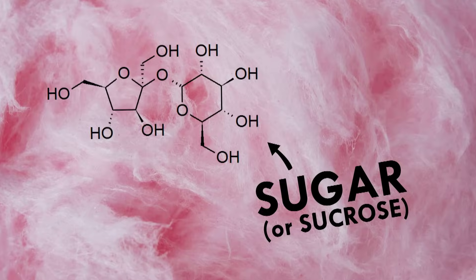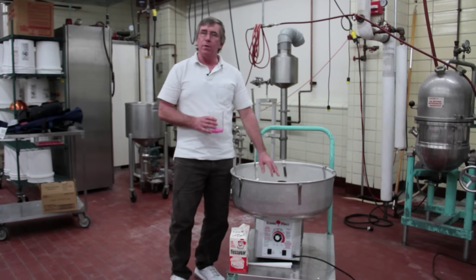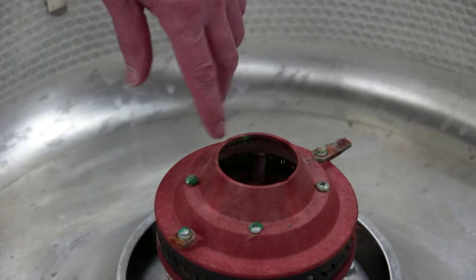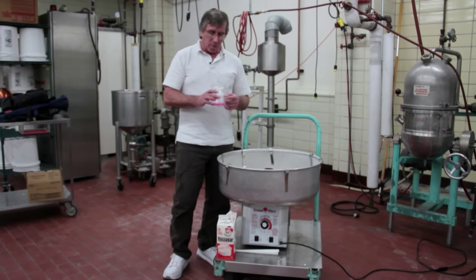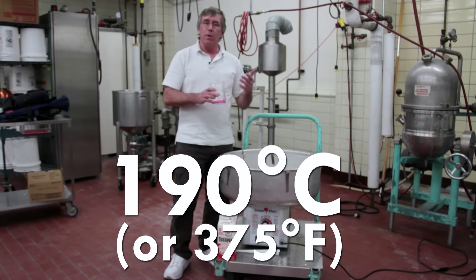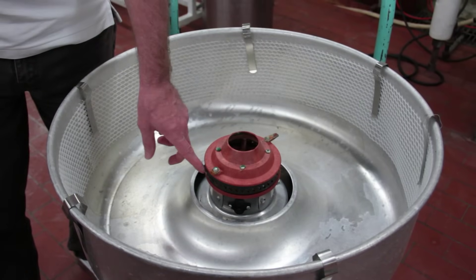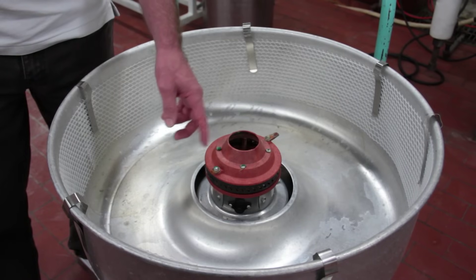What we're going to do is pour these sugar crystals into the center of a spinning device. This is a cotton candy machine. Inside here are heating elements, similar to a toaster coil. That heating element, once I turn it on, is going to warm this sugar up above its melting point — heat it above 190 degrees centigrade and turn it into a liquid. Then there are holes on the outside of this spinning device, and the liquid inside is going to be spun out through those holes by centrifugal force.